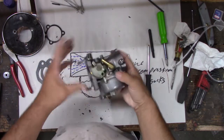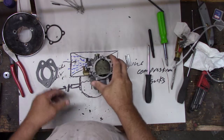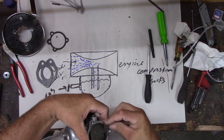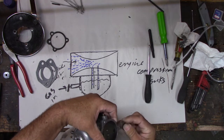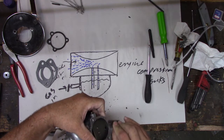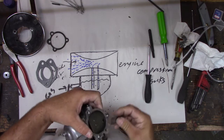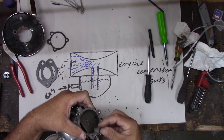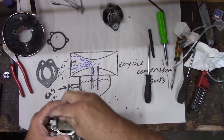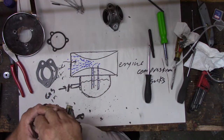All right. So this, we can definitely put the air cleaner back on, right? Yep. There's the mounting plate. Yep. Get these cleaned up too. Then you may do the honors of starting this gasket. This gasket's not as bad, not as important as the other one. Yep. The other one blocks off the air to this intake. You don't want any leaks in here. Yeah. This one just connects it to that air cleaner and keeps dirt and stuff out.